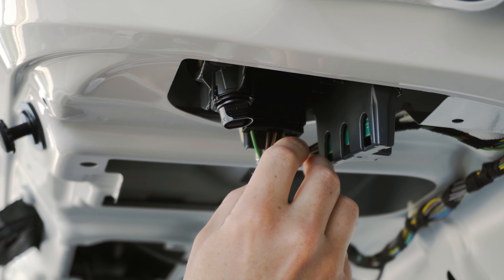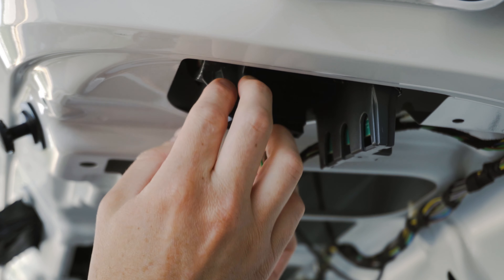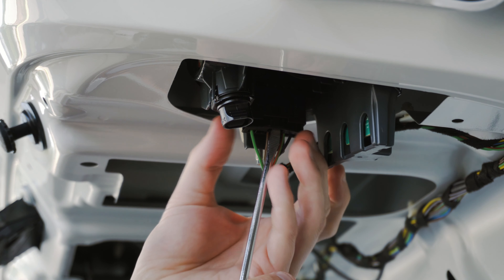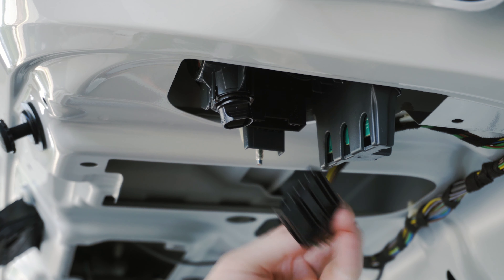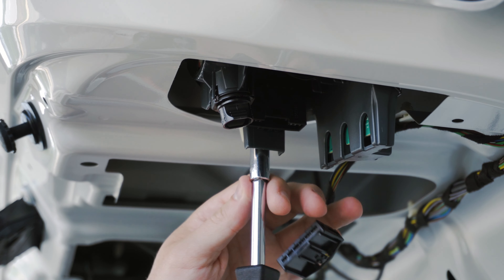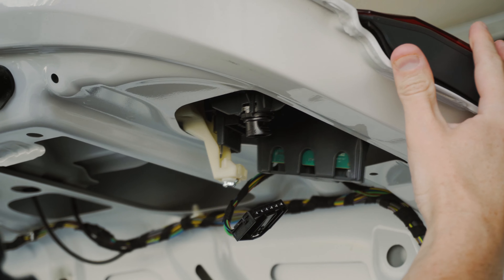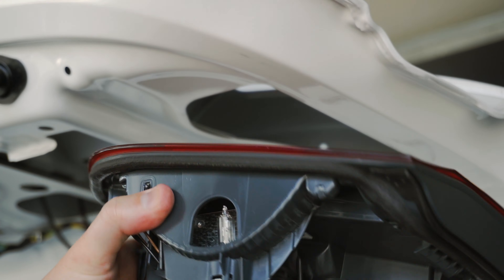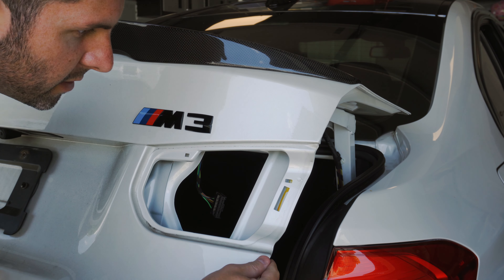Now that we're finally ready to get to the taillight — it can vary slightly by model year, but mine is a 2016. We need to take out the little harness and the 8mm bolt to get this portion of the taillight out. There's just a little clip you pull back and slide down. That comes out, and then the bolt hidden from view is an 8mm — get a socket and take it off. And there she is: the old taillight.